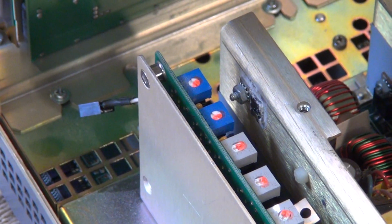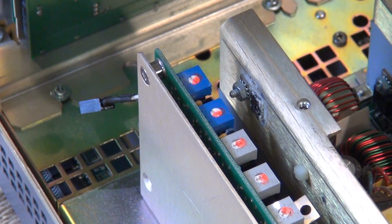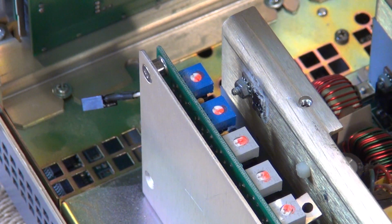Well, wouldn't you know it, after a little more poking around here, I got it to turn on. I found the culprit. That negative 12 volt line I was talking about there actually isn't supposed to be a 12 volt line. That is supposed to be another ground. I went over to the main board with the oscilloscope and measured it, and it is ground connected. I thought it was negative 12 shorted out, but it actually looks like the negative 12 volt line is not used at all in this system, at least not as actually connected to the oscilloscope.